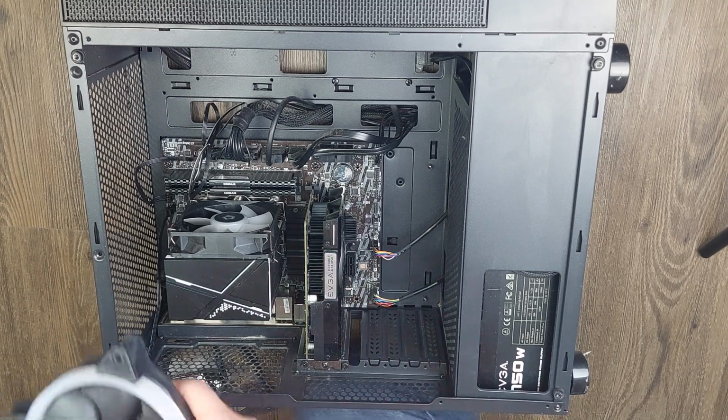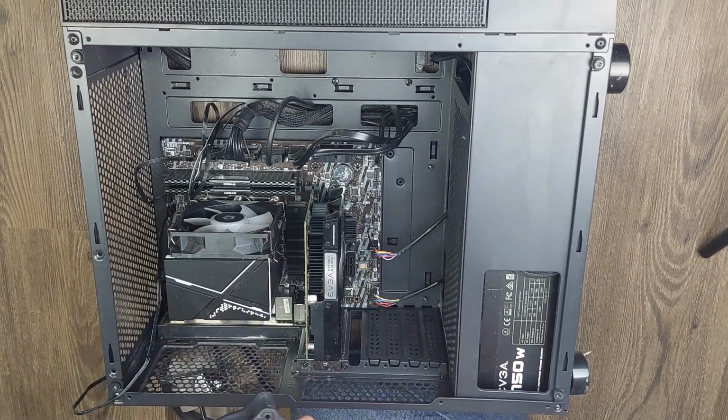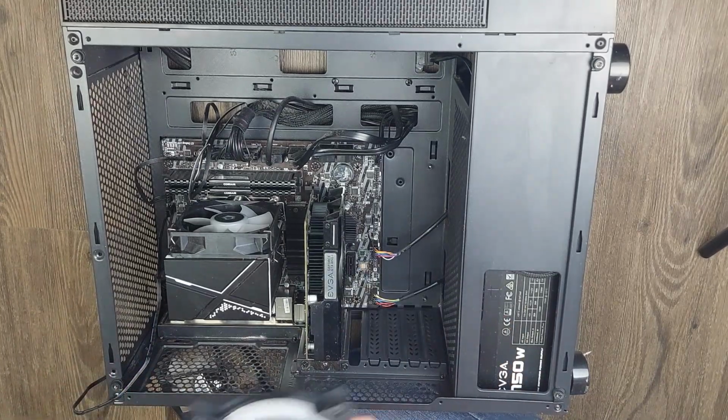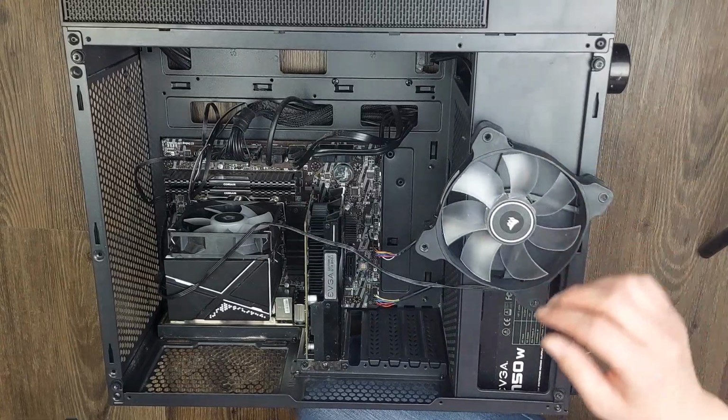The issue when I went to replace the fan was that this turned out to be the master fan, and his 2 fans in the very front of the computer were slave fans. So they relied on the connectors that this fan has. So the issue was that the replacement fan does not have those same connectors that are needed. For a while there, I still had that old fan installed, but just sitting on top of the computer so that it could run the front fans, and if I sat it upright, it didn't make the weird noise. So that was my temporary solution. I had his computer completely disassembled. I had the back panel off, so today I fixed it.